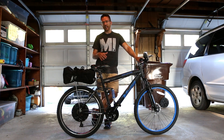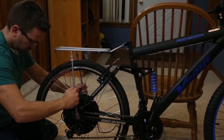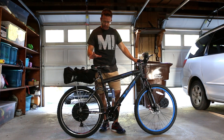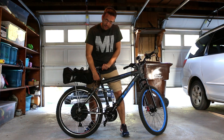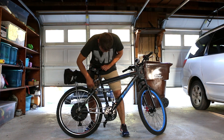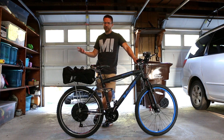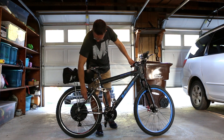Over those 11 and a half miles, the handling is not the best. There's a lot of weight sitting on the back, plus the hub being in the back. I had complaints about the rack — people saying I made a soft tail into a hard tail because I'm mounting it right here. And that's true, I won't deny that. But when I push down on it, it actually still has quite a bit of give because it still pivots right here. It's not the best though — if you could bend these arms all the way down, that'd be ideal. Really, just buying a different rack is probably your best solution, and a $30 rack would fix that. You want one that mounts to the seat post, but if the seat post isn't strong enough, then you want little arms like this attached as well.